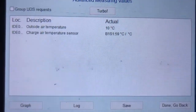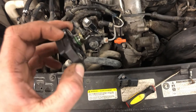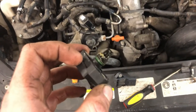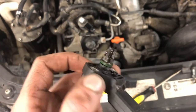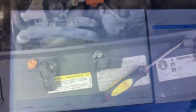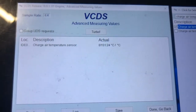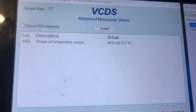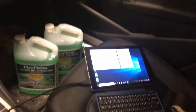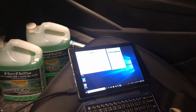So here's the old one out. It's probably got a couple thousand K on it and it's already starting to accumulate some gunk on it, not near as bad as before. We'll pop this new one in and see what it reads. So with the new sensor plugged in, we're down to 24 degrees — I've got the heat set at 20, so it can't be too far off. We're going to get the battery charged up because I've killed the battery, and then we're going to go for a drive and see if that code comes back.